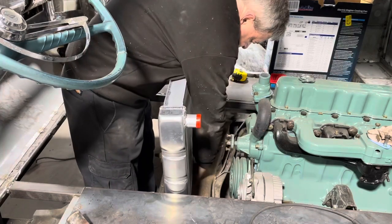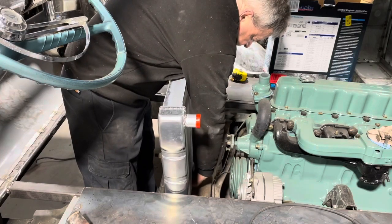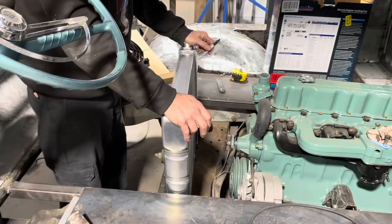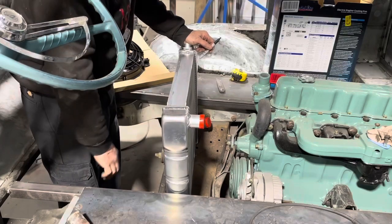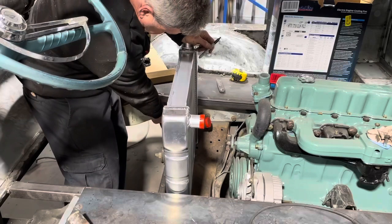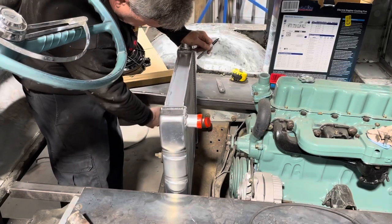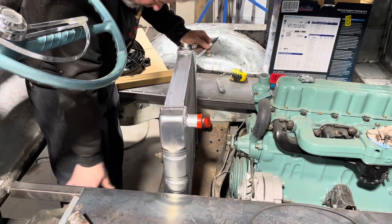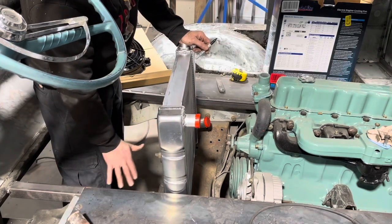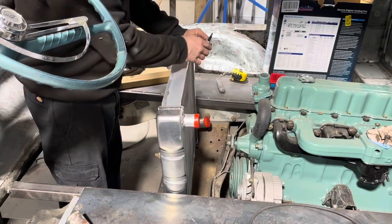Probably need to make a sheet metal piece here, so I don't want a bunch of air going under the radiator. I want the air to be forced up in the radiator. And then up here, we're gonna make a... I guess you can see it on the frame rail there. We're gonna make a sheet metal pan that kind of covers this, and the air coming in the grill will be forced up through that pan up into the radiator. So I don't want all my air bypassing the radiator,